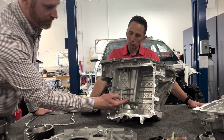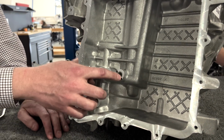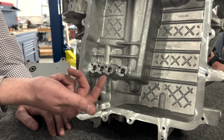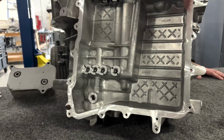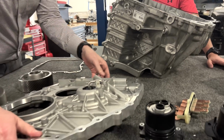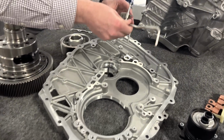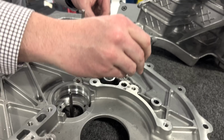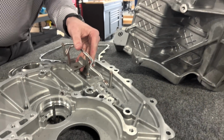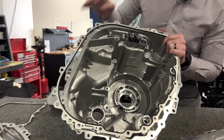Again, what we're seeing here for these ports, there's multiple ports. I'm not exactly sure what all of them are for. These are all filled with plugs, but essentially this is being driven across the top of the stator, and I'll flip this around so you can see. So we have these very discrete cooling ports that we showed here that are supplying the stator with oil. These are shooting directly into here. These go against the phase leads to the top here, which are cooling.